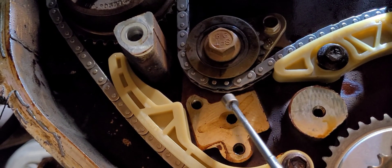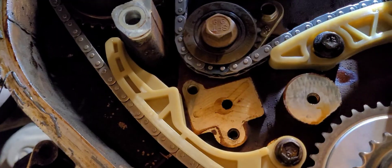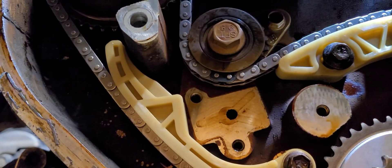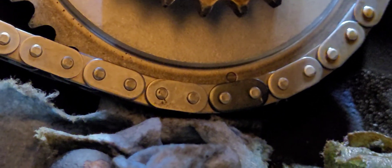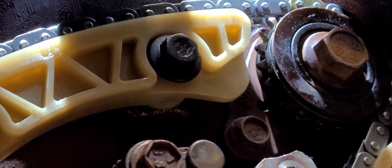And then on this one, it's really tough to see. Of course, there's a black link, but there's a line on the sprocket right there. And there's a line on that one up there as well. So if you look real close, let me see if I can zoom in for you guys. You can see it there, so that one lines up. And the same thing goes for the crankshaft sprocket. Your black goes there. Black to the exhaust. Gold to the intake. Just remember that and you'll have it.